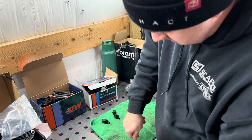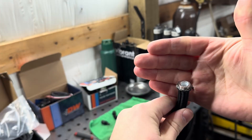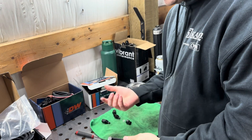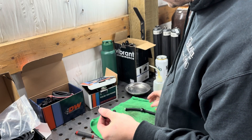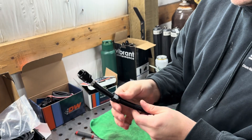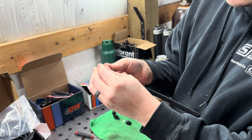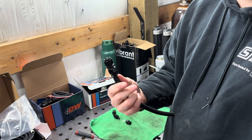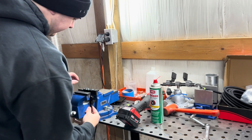The crush sleeve is kind of hard to get on there sometimes — use some force. Slide it so the PTFE is fully butted up to the inside lip. Then take a little engine oil, get that into the PTFE, and slide the barb piece all the way in. Slide the collar up and start threading it in by hand — you can look inside to make sure the barb isn't sliding out of the PTFE. You won't be able to get it all the way by hand, so move to the vice.